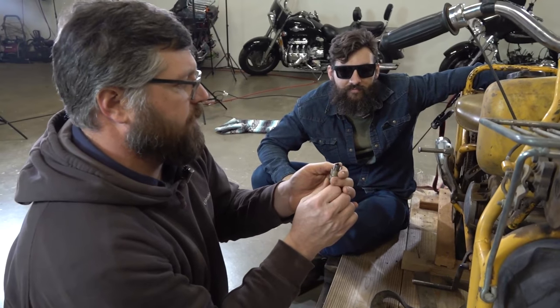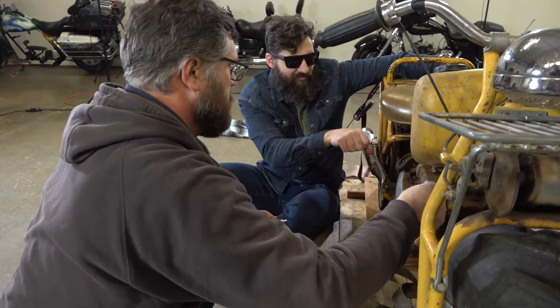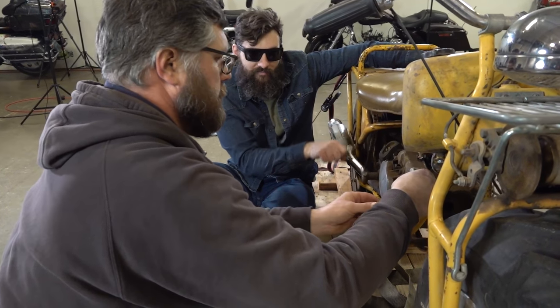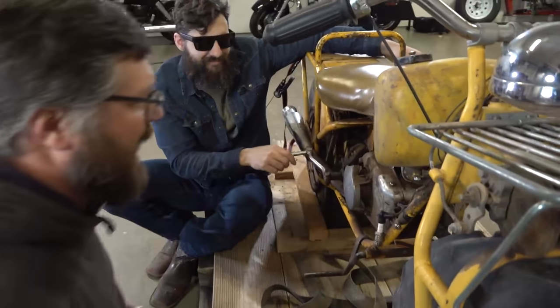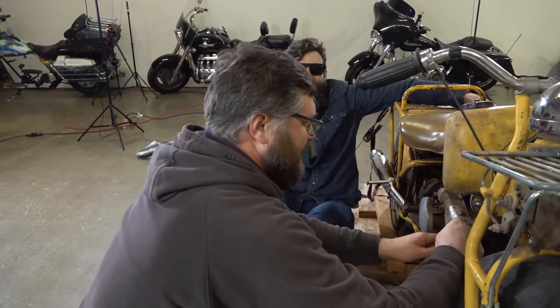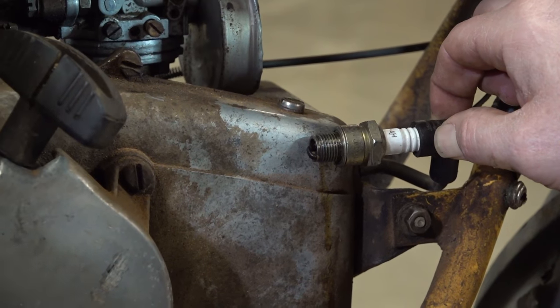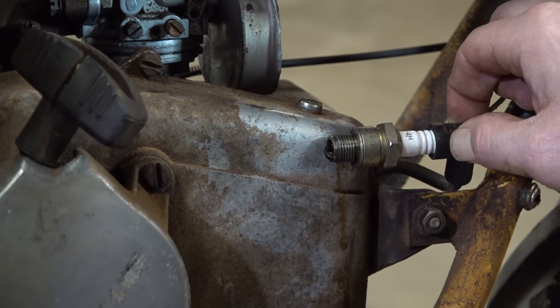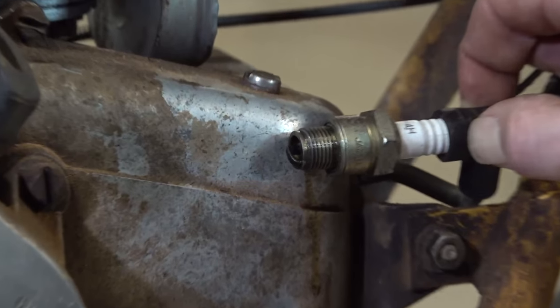It's wet — it's getting some fuel. After you confirm that the engine is not locked up, the next thing to do is check for spark. The louder your friend yells, the better the spark. We got spark! That's a strong amount of spark — it's blue.